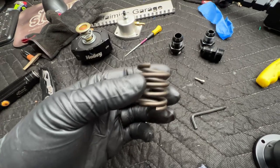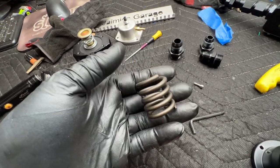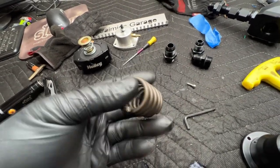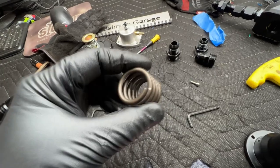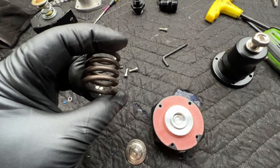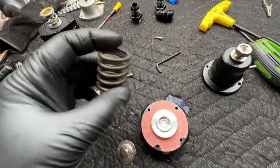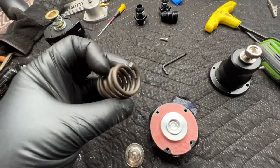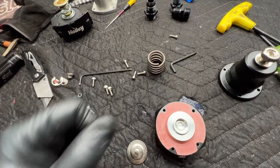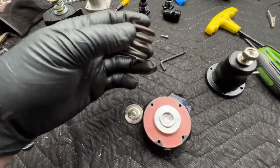So we're just going to cut this guy down for a fun experiment and see if we can get our pressure under 80 pounds, because I'm assuming it wasn't returning at all. My return line was loose right around my flex fuel sensor and nothing was leaking. My assumption is it was hitting the 83 pound internal bypass on the fuel pump. So we're going to put that guy in and try to get 40 out of it.